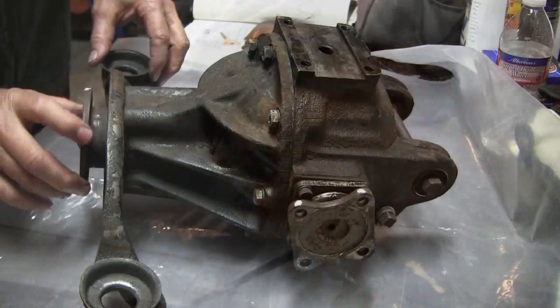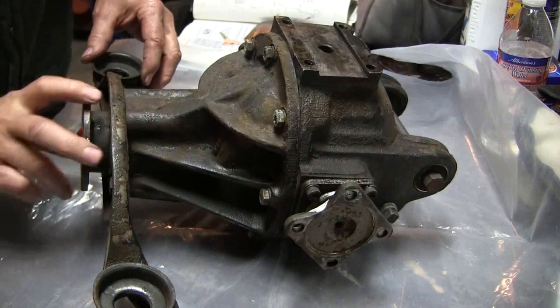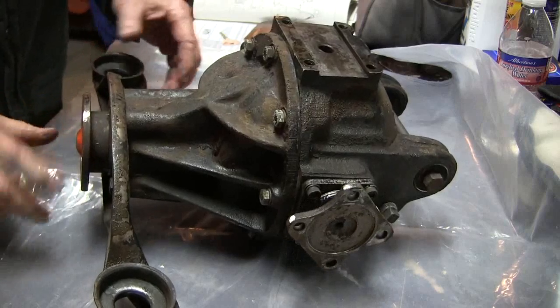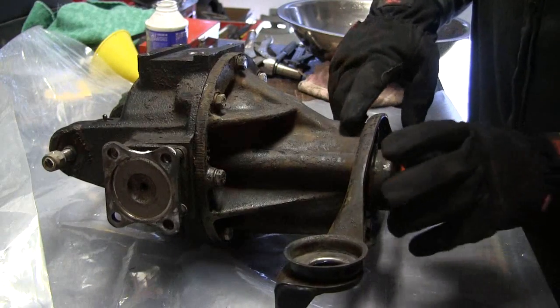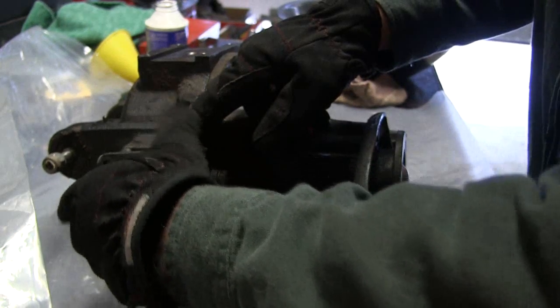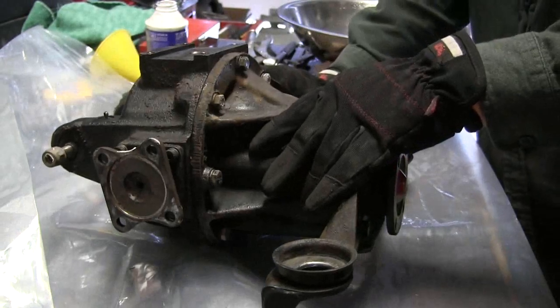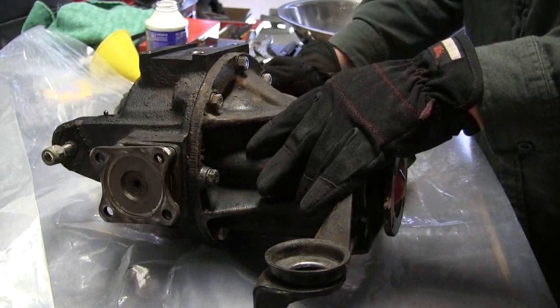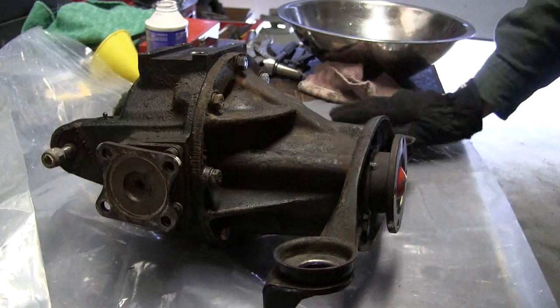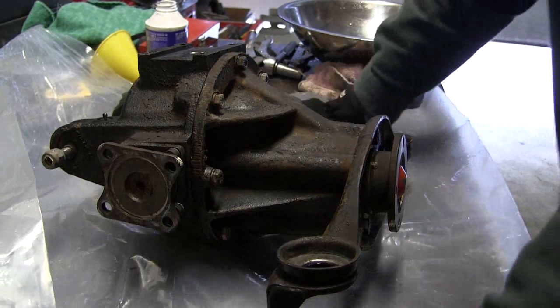Twisted a few parts and found some things. That's almost spinning freely — there is no preload on those bearings now. I don't feel anything at this bearing, but I can feel a little bit of thumping going on there. Turn the right one and I got a clunk clunk. Open her up, drain it out, and see what that clunk clunk is.